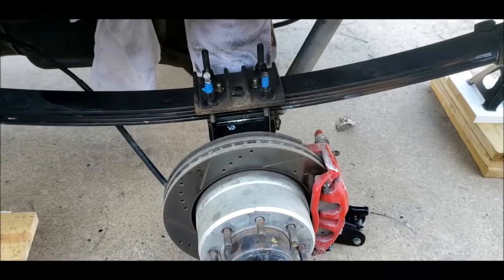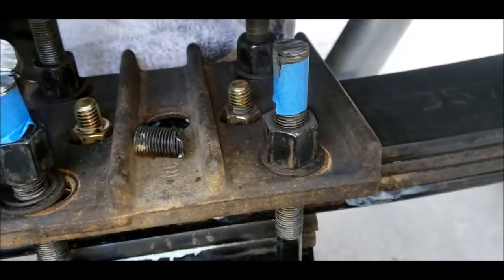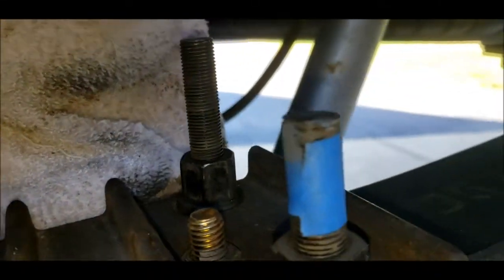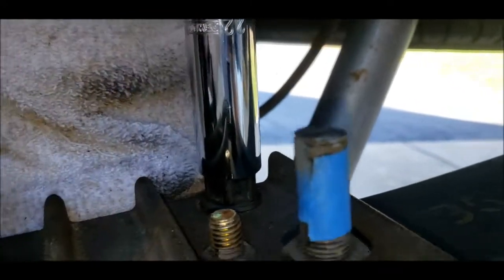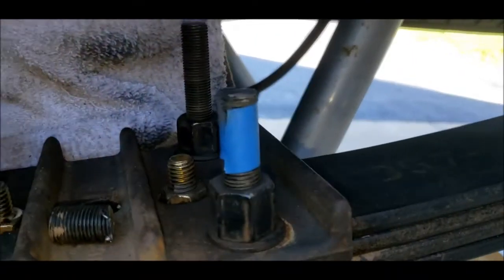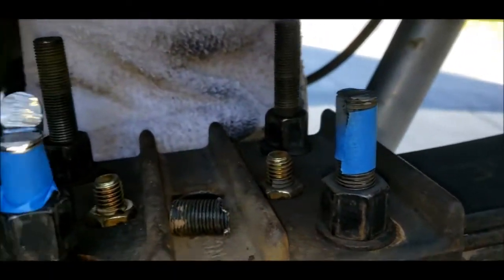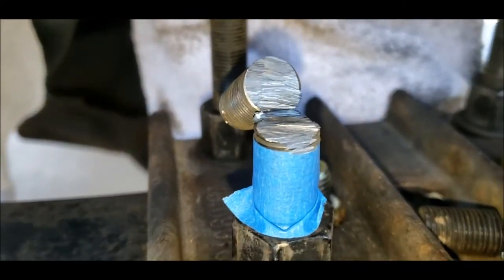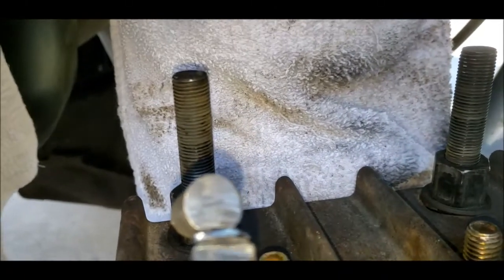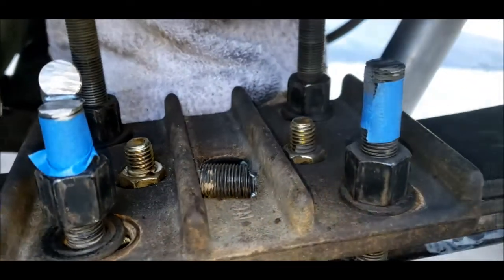All right, new day, and I'm grinding. I got the U-bolts on, not torqued or anything. Ran into a height issue, and I wasn't planning on trimming them because I didn't really care about the extras, but my deep socket still does not fit, so I'm gonna have to trim them down so that I can fit over them to torque them down properly. So I'm going at it with an angle grinder right now. I might try a Dremel on one of them and see how it goes, but it's some intense steel, so I think the angle grinder is probably more up for the job.